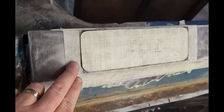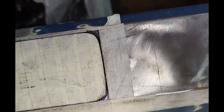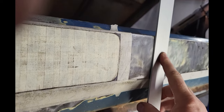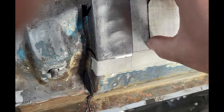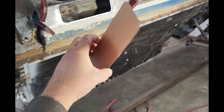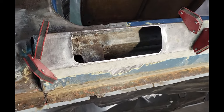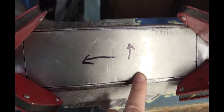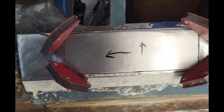I got that piece just about trimmed up. It still needs a little adjustment here and there but it's fitting in there pretty decent. I want a little gap all the way around it so that I can weld it. One thing to keep in mind is that this rocker piece is not completely flat — there's a little bit of a gap where it just kind of rocks around, so I'm putting it over in the vise and very gently bending it to put a little curvature in it. I painted the back of it with some weld-through primer to try and protect it from rusting. Here it is fit into place — nice little gap all the way around, edges flush with the existing rocker panel. I think we start welding her in.